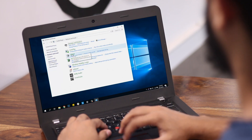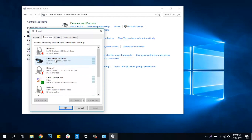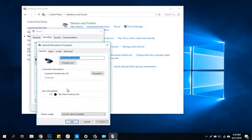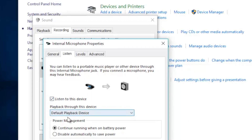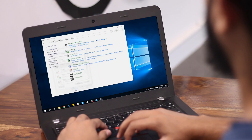The Sound dialog box will show you all the devices connected to the computer, including the mic we just set up. Go to the Recording tab and make sure the aux cable is connected to the mic input on the computer, otherwise it may not show up on the list. Right-click on the internal mic option and open the Properties window. Click on the Listen tab, then check the box against Listen to this device. Now your computer will play back whatever sound it picks up on the mic port to your default audio output.